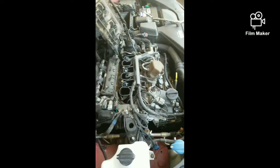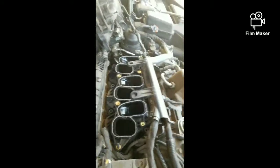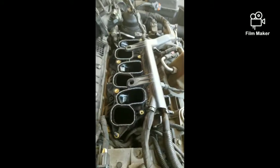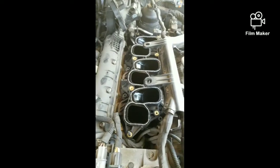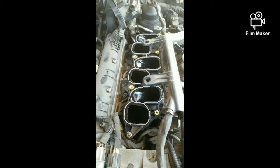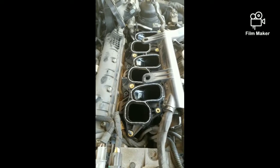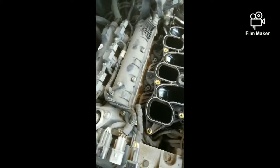It's a pretty versatile motor for Hyundai — haven't had too many issues with it. While I was at it, I also replaced the intake gasket on this car because it had a little oil residue on it. That's cheap insurance — $20 — you might as well kill two birds with one stone. While you're in there, it won't take that long, just change it out.